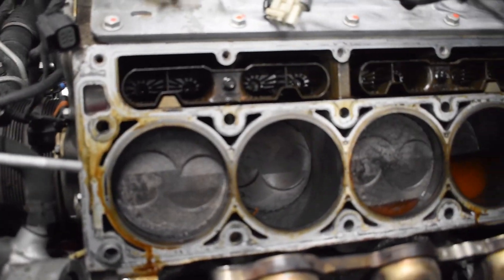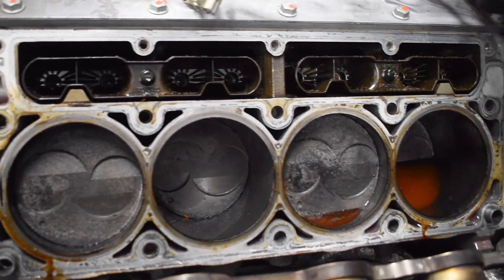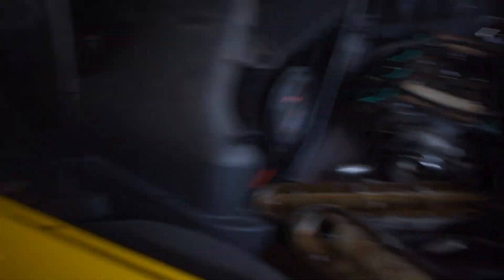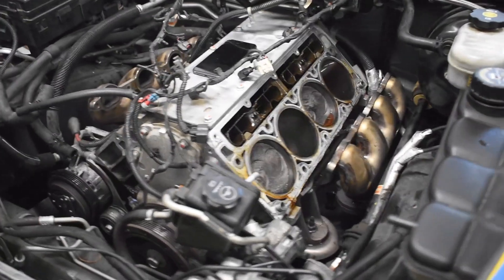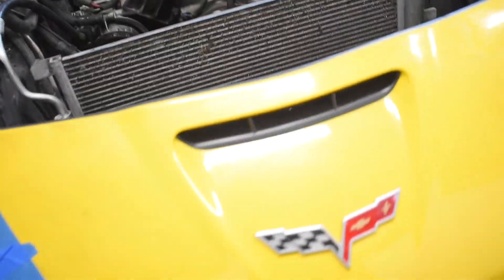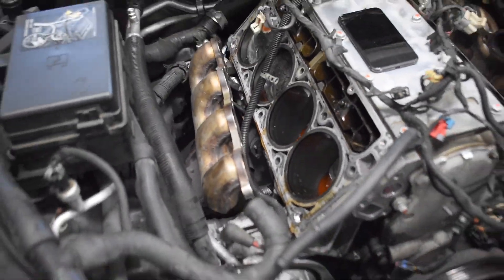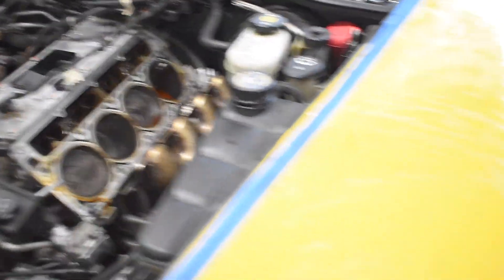Want to give the deck a good clean and see how much effort it takes to get these pistons back in good condition — one is squibbing just a little bit. The heads will also need the deck surface cleaned. Now for the tricky process: lowering the cradle to get to the crank bolt. I'm going to give it a shot pulling the factory headers straight up from here rather than shimmying them down from the bottom. If they don't clear I'll jack the car back up and drop them from underneath.